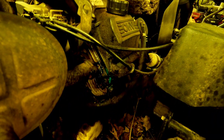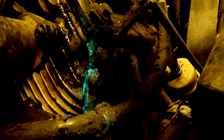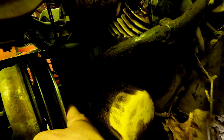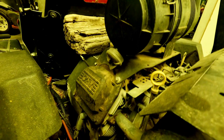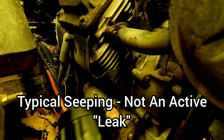Starting at the valve cover — the most prominent place — we've got leakage coming from all over the valve cover. You can see that very easily. The oil filter is leaking too; I wonder if it's just loose a little bit. I don't see any other seepage on this side. No seepage down at the sump gasket or PTO seal at the front. Looking right where the shaft comes out — if it's all wet in there that would need replacing — but you would be able to see the UV dye if that were the case. On this one, not really much oil over here; I don't see any active leaking coming from it whatsoever — I'd say that one's okay.